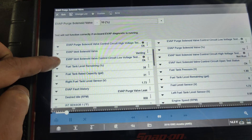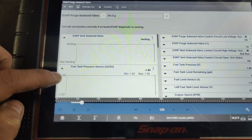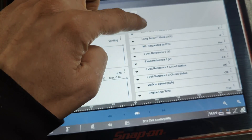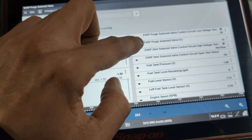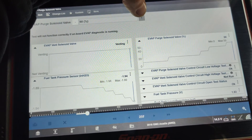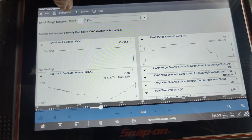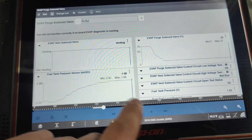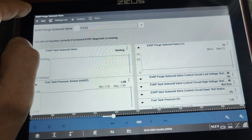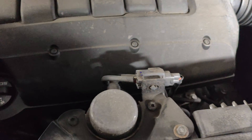Let's go in here — fuel tank pressure. Where's purge? Just look at that. Make sure it's still venting on the purge — they said sometimes this thing will run rough too. Purge valve right there at ten percent. Command this up. We'll keep pulling it down into more and more of a vacuum, but we stay in a vacuum. It says ten percent — we're not going to go below ten percent. So what we're going to do is pop this cover off, go to the purge valve, and disconnect it to see if we still got flow.